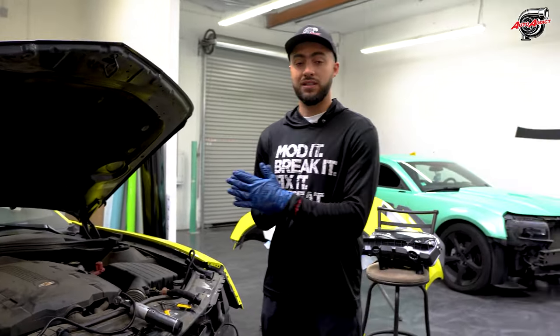Now, the first thing is, as you can see, there's a black and a green wire, which indicates negative and positive. This we'll put on the side. We've got to take out the green socket by reverse engineering how they twist it to install. I take out the bracket and let's show you guys the bulbs. Okay, so a D2S bulb looks like this, guys. We're also upgrading our bulbs as we get to know these headlights more and more. We used to have a little red connector that connects into this, but now we're cutting everything away to make sure everything is plug and play.